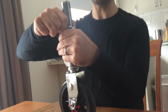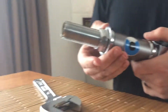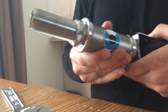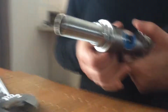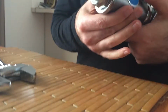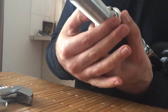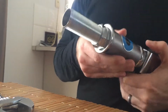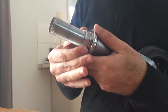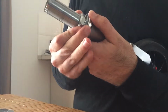Now the trick here is you want to tighten the top nut without tightening the bottom one. So when you go to tighten this, like I said, no vertical movement, but lots of free play. And just allow a fraction of a turn the opposite way, only because when you go to tighten it, it will turn with it. So hold it and tighten as much as you can by hand. Here we go. Make sure that this is still fine. No, it's gone a bit tight. So rotate that a bit that way. Tighten it with your fingers.